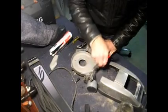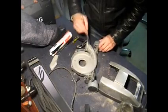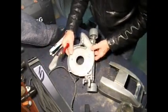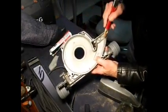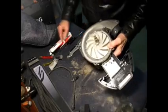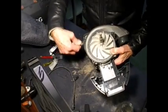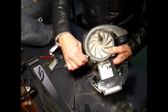This is my workshop machine so I could clean it up even more, but you must make sure to get every bit of sealant off, especially all around here. Also, while we're at it, on the moulding here you'll see a little circular stamp — this one reads 96, so this was manufactured in 1996. You can see around the body that this will have to be scraped clean as well. Give it a scrape, keep it nice and flat, don't round it off.